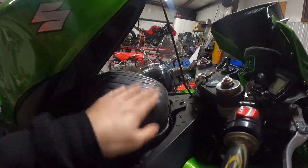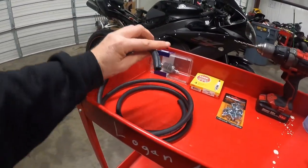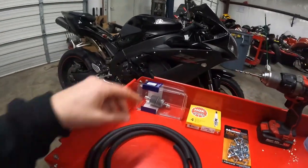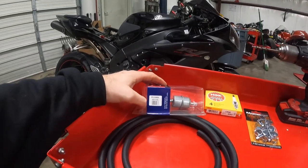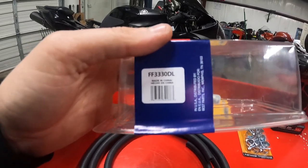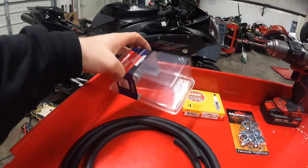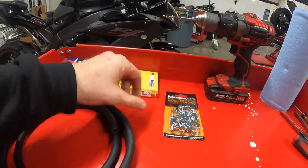He also wants to do spark plugs while we're in here. So what tools and parts do you need? I'll add a list in the description, but I'll go over them now. You're going to need 5/16 fuel hose — about two feet. You need a fuel filter; this one here is about five bucks at AutoZone. The part number is FF3330DL — I'll put that in the description. These are metal in-line filters. You need fuel injection hose clamps, which you can get at O'Reilly's.